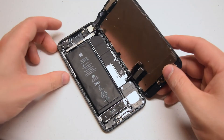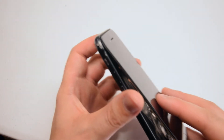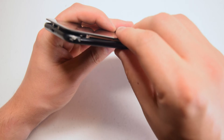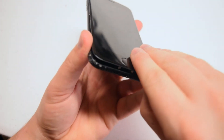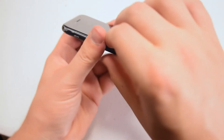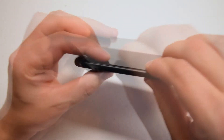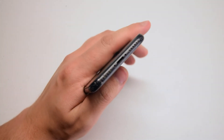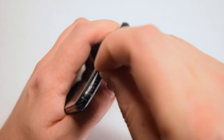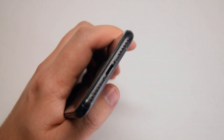We're now ready to clamp up the phone. Go ahead and fold it, and begin by tucking in the top latches first. Once those are locked in, go gently around the contour of the phone, pushing it in and finishing up the clamp. If you feel any resistance, make sure to re-seat the screen. Go around the contour and make sure it's a nice solid lock with no gaps. Now place the two Pentalobe screws into their sockets, align them, and secure them with the Pentalobe screwdriver.